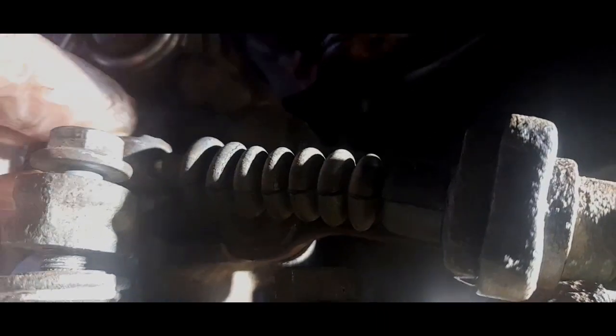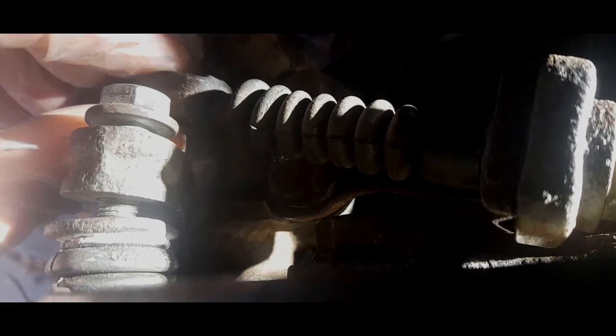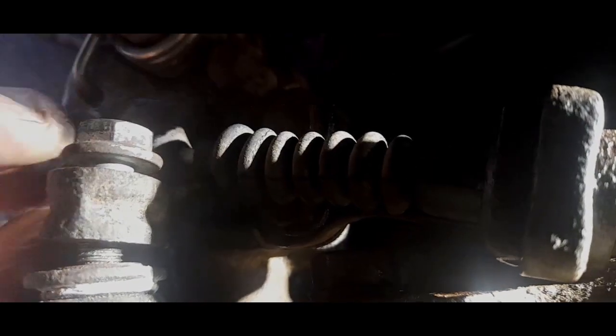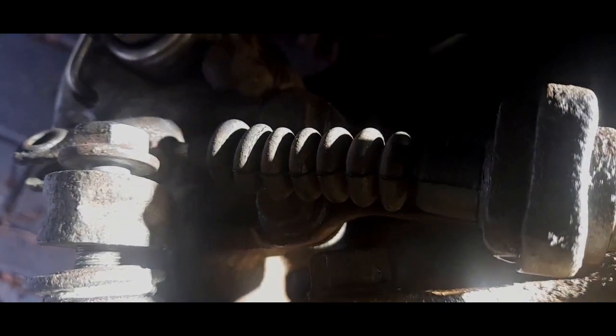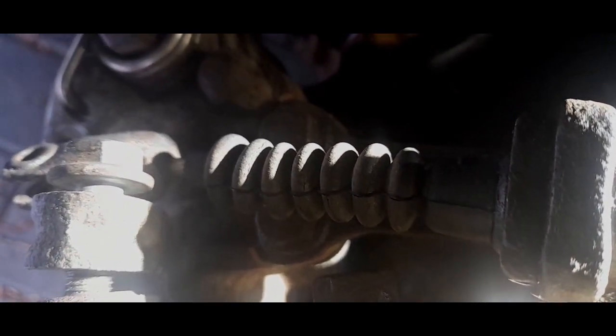This clip here is not budging. To be honest with you, it's early on a Sunday and I don't want to annoy my neighbours, so we have got another option. I'll try and take it off at a later time. You've got two bolts here that hold this bracket on - it's attached to the caliper. The new one does come with this bracket, but I'm going to take these two bolts out and just release the handbrake that way. Sometimes you've got to be careful of the amount of noise you're making.